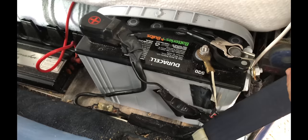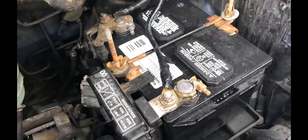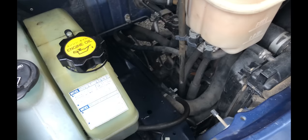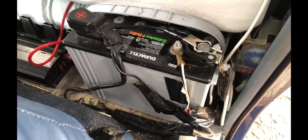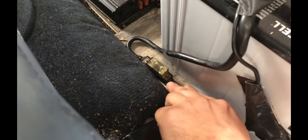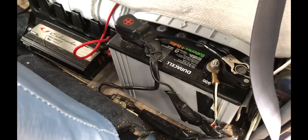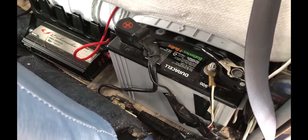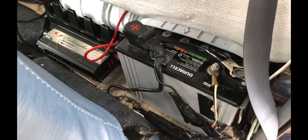It's a 750 watt inverter, and that plug runs to my charge port bank. It looks kind of rough right now — I need to get a box for it, but it's just running parallel through here. It comes through the firewall and runs into my crank battery. There's a lot of extra room under this hood because the engine's in the middle of the van. I'm thinking about adding another battery, so I'd have three total — one for cranking and then two for parking. It doesn't look super pretty, but I assure you it's safe. I also have a fuse block between the batteries, and I'll pull this fuse at night so I don't run my crank battery dead. This battery is good for what I need — I don't need much power and I drive a lot each day, so it charges pretty constantly. I could add a solar setup eventually, maybe an emergency solar setup.